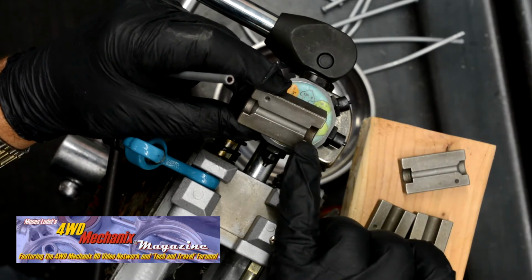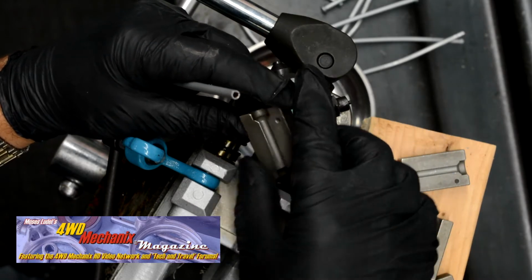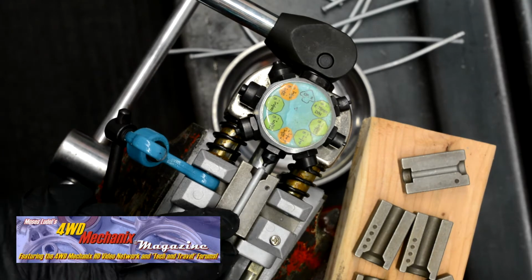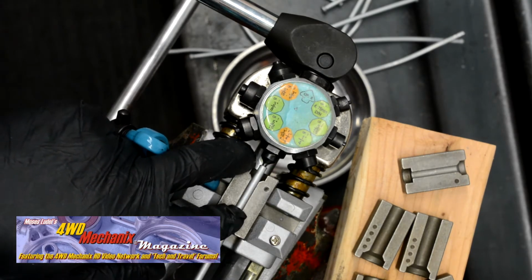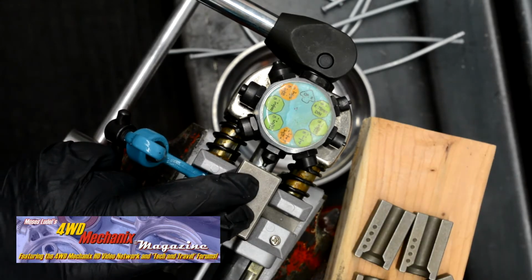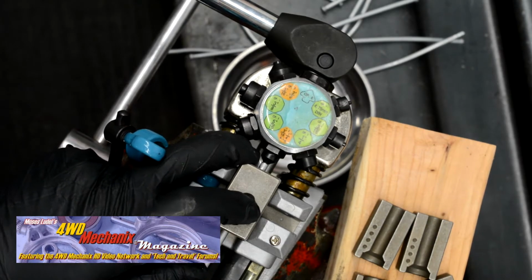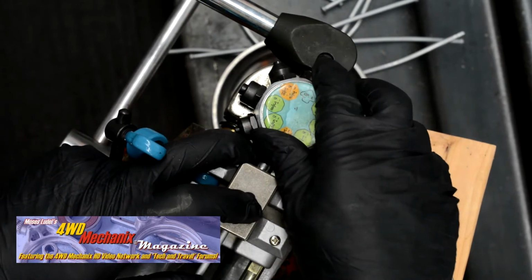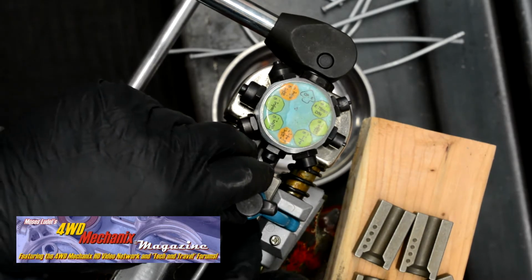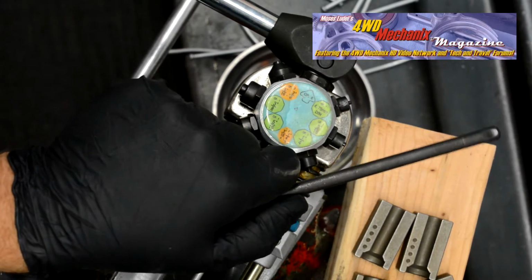The right end of this die is for DIN. The left end, or end that is now exposed, is for a single or double 45-degree inverted flare. The dies secure the tubing very well. To help keep dies from sticking to the tubing, a lubricant like Miller's red rubber grease can be used and leaves no harmful residue. With the die blocks roughly square in the fixture, move and pin the arm in place.